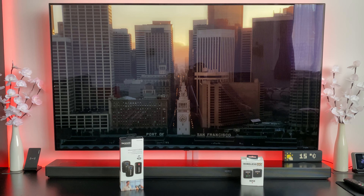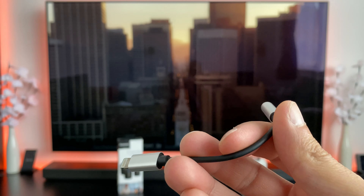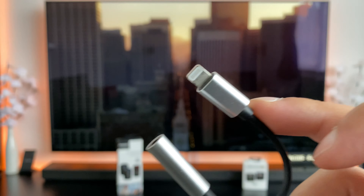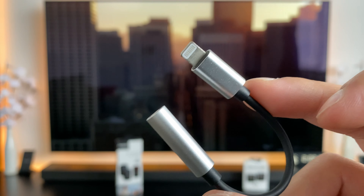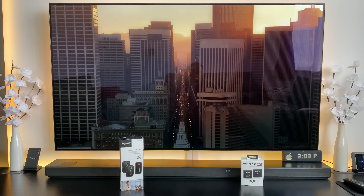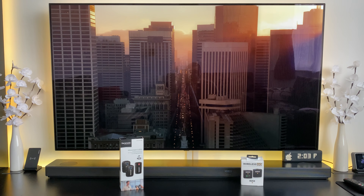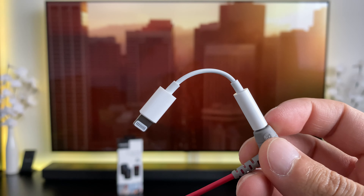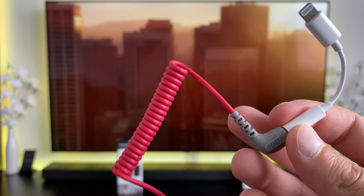Initially I was testing with a third-party lightning cable — a longer one I had around the house that works fine with every other accessory. However, with these particular microphones it wasn't detecting as a certified device, so the iPhone kept using its built-in microphone. All my initial testing sounded muffled and identical between the two. You really do need to use the original dongle or a certified Apple one.